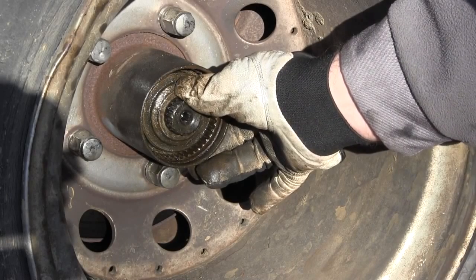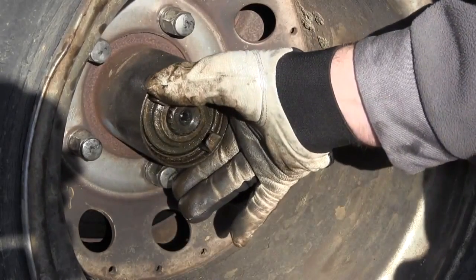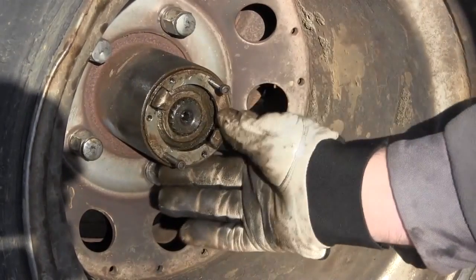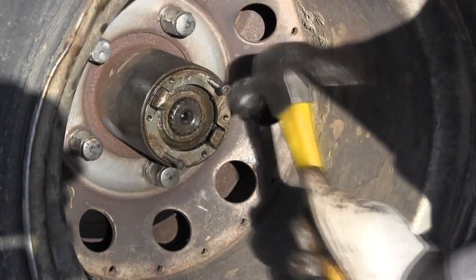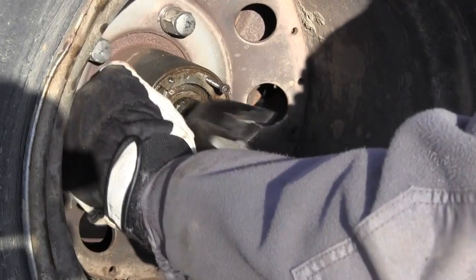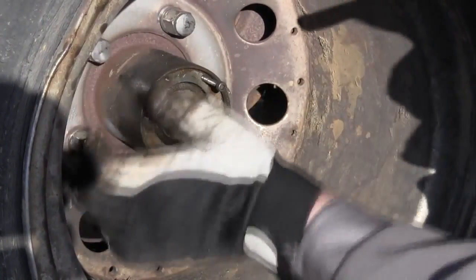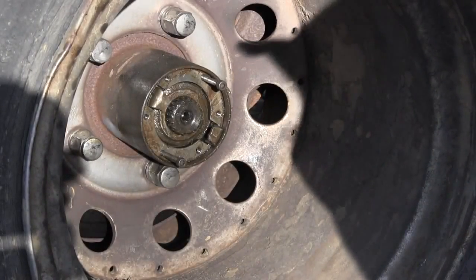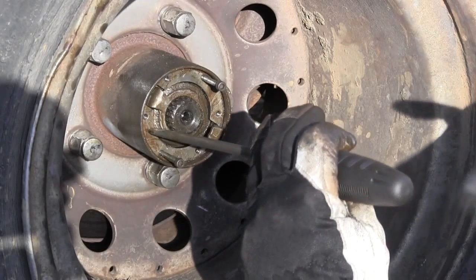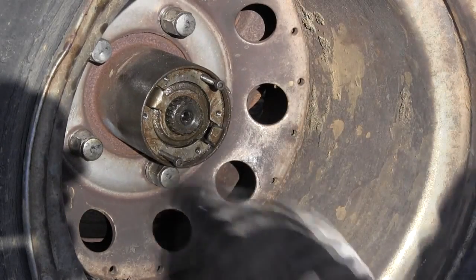Then you have a controlling ring with 2 ears that, when pushed in, opens or frees the locking hub. Outside of that is the ring with holes for the screws, locking it into place. In this case it's a little bit tight fitting, so I have to use a hammer very gently to get it into place. This ring must get inside the groove on the outside of the hub, and I'm using a screwdriver and hammer to get it into place, gently, of course.